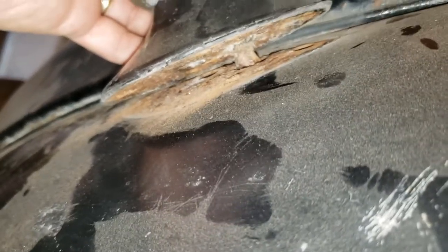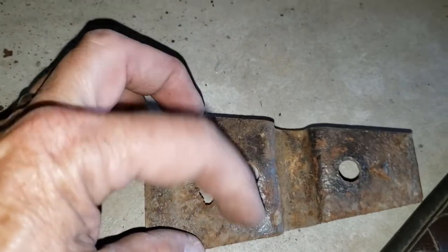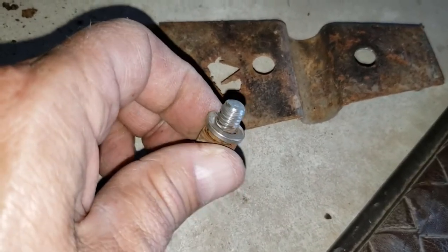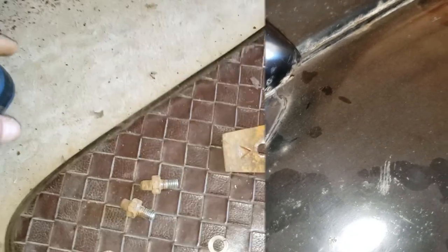I removed the two studs and the plate underneath. I can see there's a lot of corrosion here. The ground connection goes between the stud and the fender, so I'm going to clean this up as best I can. I can see it's been brushed before, but I think a wire brush isn't enough — I may take the grinding wheel to it to really make sure it's a good connection. I was able to bang on the thing and it would intermittently come on, so I need a more permanent fix.